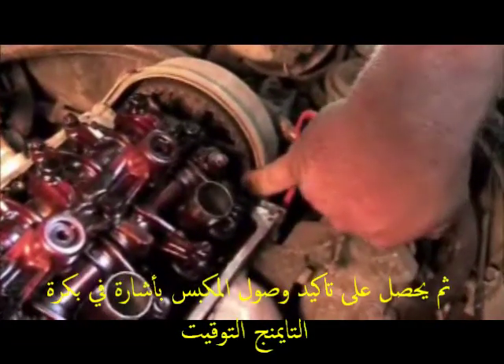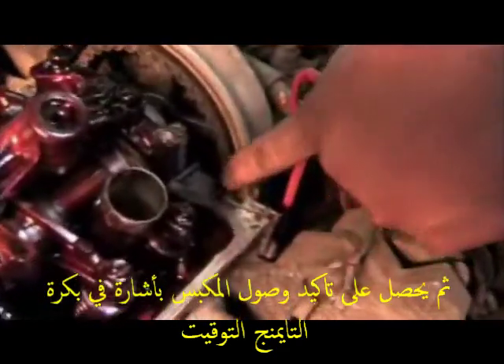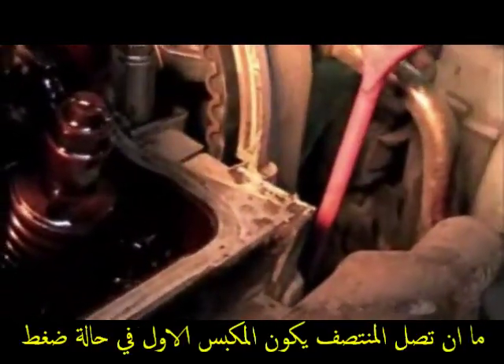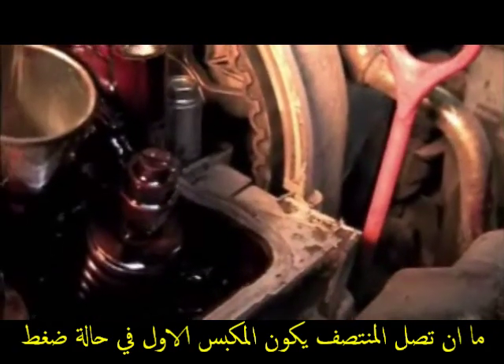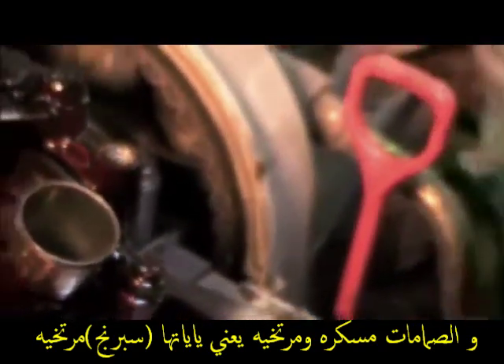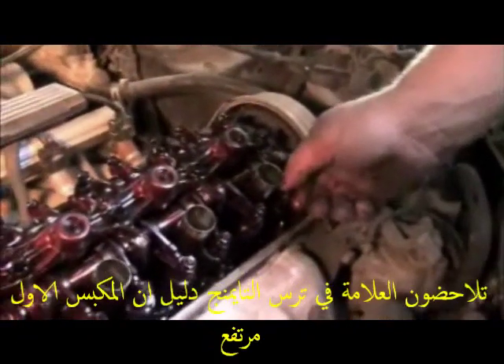While you're turning it over, you want to look for these little lines on the back of the cam gear. There's just a little bitty straight mark cut into the cam gear, and you want to have these flush with the head. Once you get that lined up, you'll check. You'll either be on number one or number four. Whatever the valves are loose on — that's the cylinder you're on.